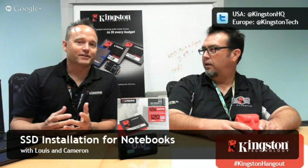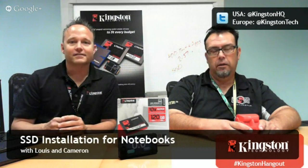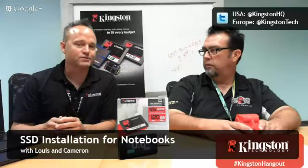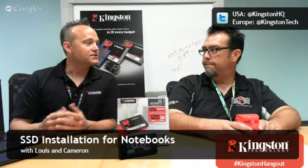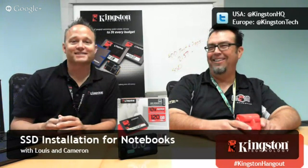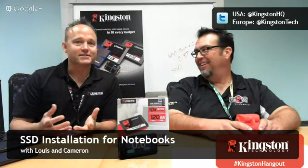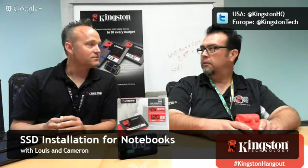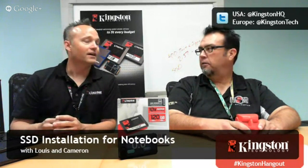Right? So we took a pair of LSI's latest generation host controllers. No RAID, just straight HBAs, and we attached 16 of our HyperX SSDs to that. Just 16. We did a RAID 0 stripe in Windows across those 16 drives, and we got over 6,000 megabytes a second read and write. So that's pretty cool. And PCI Express 3.0 kind of made that possible.